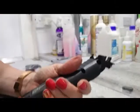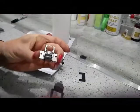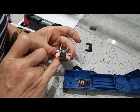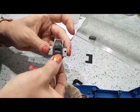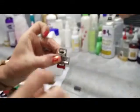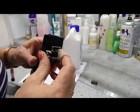Now we're going to assemble the back piece. This piece came off in one piece but it does actually come apart, and it may well come apart as you're reassembling it. Bear in mind there are two little pins — this one and that one — and two tiny holes here and here, and they have to sit on the pins. Make sure it's completely seated so that the finished assembly has an equal size gap at the bottom.